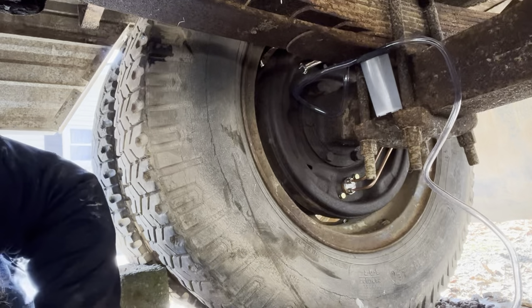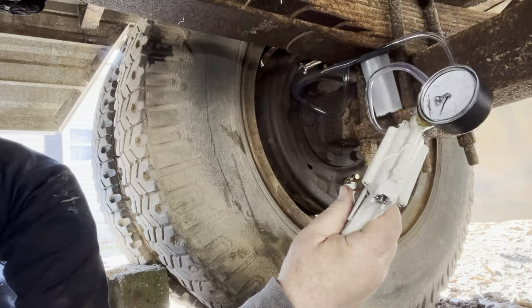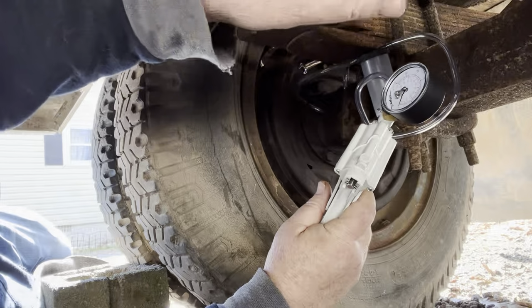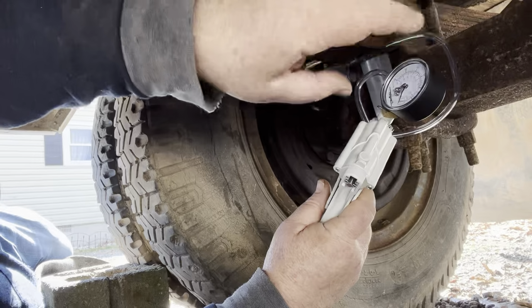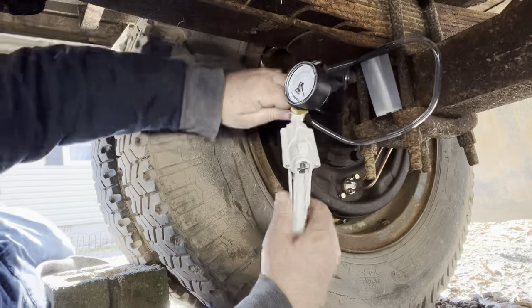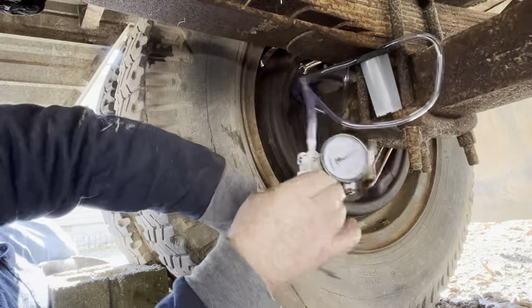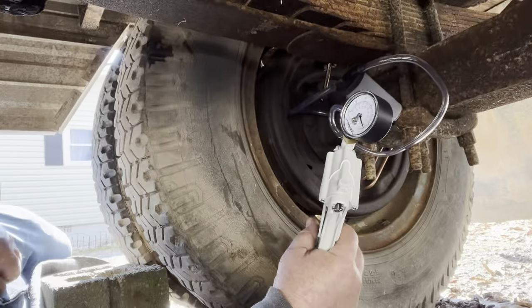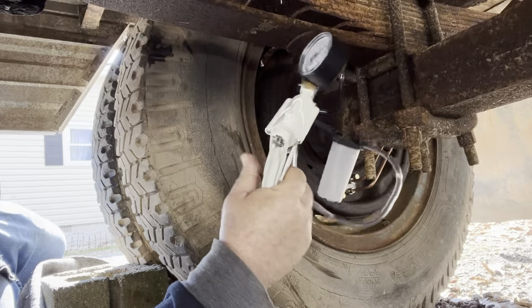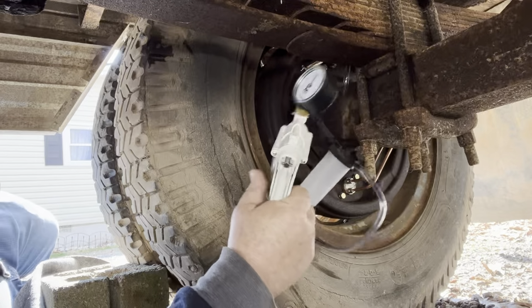All right, it didn't use any fluid, but we're moving. So I checked the bleeder on the other side, and it wasn't that it was loose, it just wasn't tight. And so if fluid gets up to the center little block up there, it'd rather suck the air from the other bleeder than the fluid through the line. Maybe I was sucking air through the other bleeder. I mean, I have seen spurts of brake fluid on it one time.